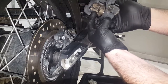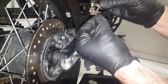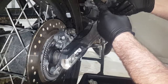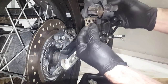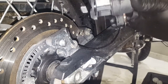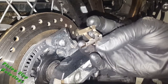With the C-clamp removed you can access the inner rattle clip. Just grab it and pull it out. Some of them will have a directional arrow indicating which way they go in — this one isn't directional front to back but there is a notch or a lump in the caliper that it seats into. Go ahead and scrub it clean with the same soapy water you cleaned the caliper with, and clean up inside the cavity where you couldn't reach before. Now you can see how clean that cavity really is compared to before when it was all grimy and grungy.